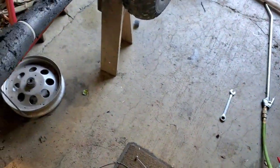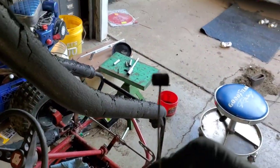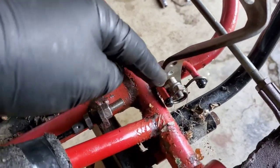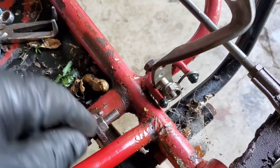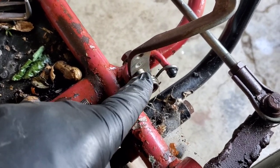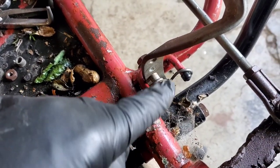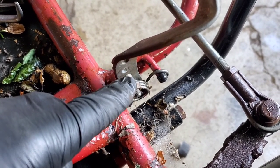Now the thing I'm working on now, I say now a lot, you have the barrel end for the brake cable I'm using. Now I need to connect it to this part here. Now I could just go lazy and just pass it through and angle it over, but there's tons of room, so I'm actually going to utilize this spacer, because this was the throttle cable before. What I'm going to do is cut a small piece of angle iron, drill to the size of that spacer so that it moves, and then bolt that in down tight, and then put the barrel end on the other side, come flat and then over, then I'll put the barrel end in there coming back to the throttle cable holder bracket thing.